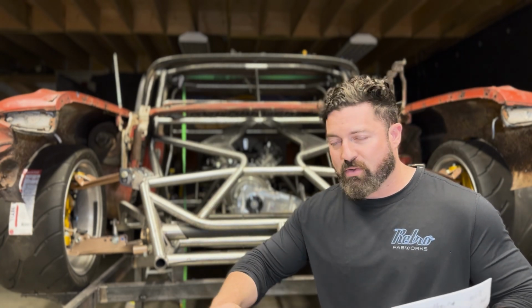This is actually secret. I didn't tell you guys this or show you this. I'm actually using a Corvette rear bearing, which is splined, and I'm putting it to the front. That's how I'm getting engagement to the CV axles to the front hubs.